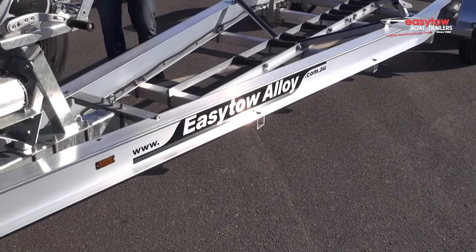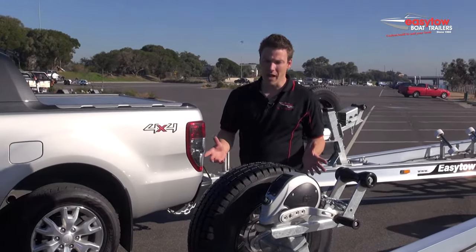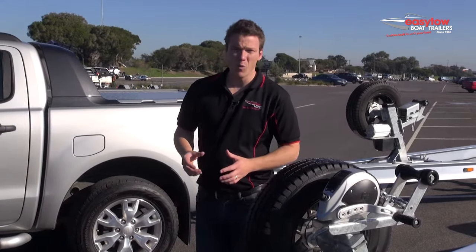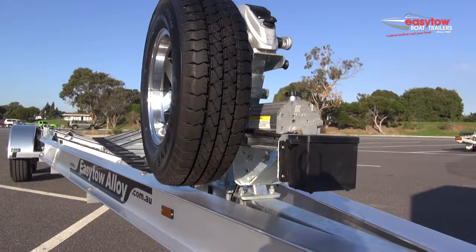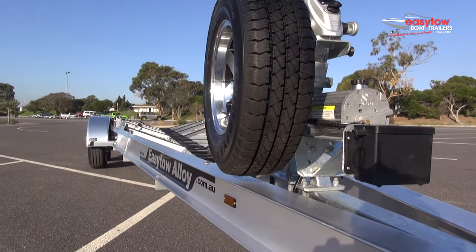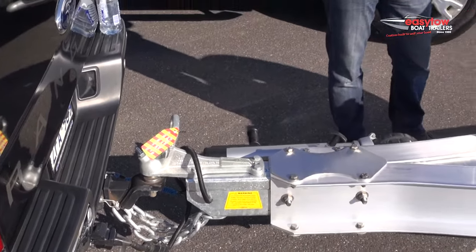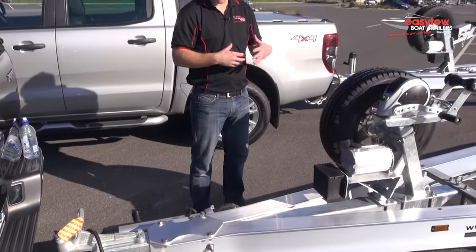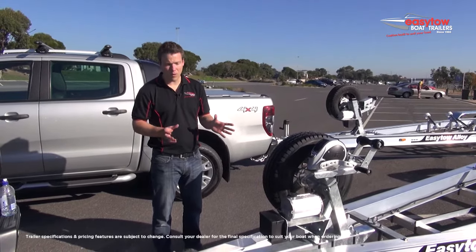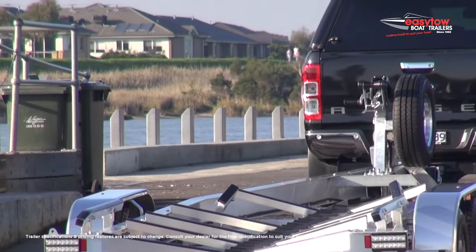So let's take a closer look at the construction of these trailers. We've been building steel trailers for nearly 50 years, so when we launched into aluminium we did extensive research and development on the product and gained a lot of feedback from the market. What was common was that they flex too much. You can see here we've up-specced the I-beam to one to two sizes more than what is currently on the market. This has reduced the flex through the total trailer and provides a better towing experience. Our unique design incorporates a steel drawbar and steel winch post. Some people may say in an aluminium trailer you've got steel in the trailer — we've done this for strength, and the reality is your drawbar and winch post are not in an area that goes in the water, which of course minimises the chance of corrosion.